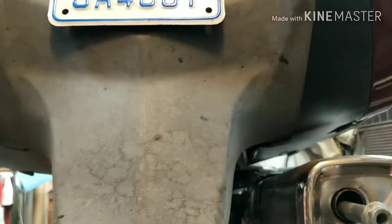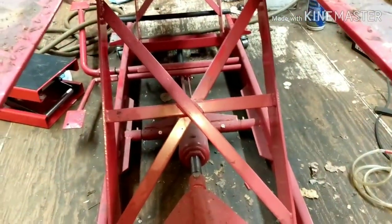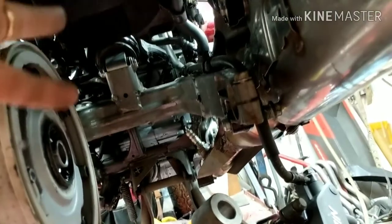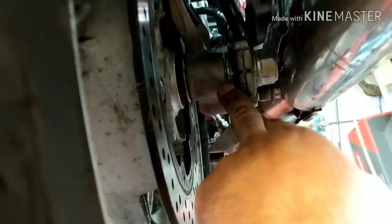I'm going to put the back wheel on. So putting the wheel back in — you can see I still have all the bags and everything on. I do have a lift that's got a dropout in it. I'm going to lift it up enough to get the wheel up underneath here. I'm going to work the caliper bracket and everything kind of up above it until I get the wheel in, and then just finagle it around to get it back in. So we got it back in here. I'm just going to go ahead and tighten up the axle, then the pinch bolt here to hold that spacer in place, then tighten up the caliper mount right there. We'll pump the brakes up and get everything lined back up again.